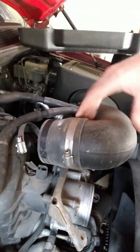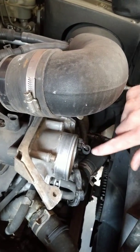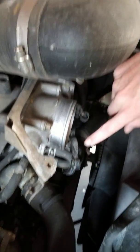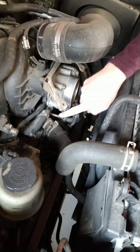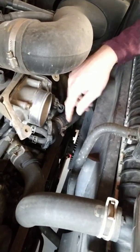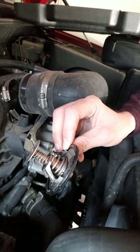All right, so here I am under the hood of the vehicle. I'll show you what I've done already. I've taken off the airflow first — you take off the airflow which is connected in here. I also unbolted this here, which is the airflow into the intake manifold, but you don't need to because the other bolts are right underneath it. This is where you've got your main upper line coming through here, and you just need to unhook right here. I've already taken out the thermostat, so this is the old one and we're just going to pop in the new one and put it back together.